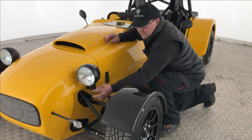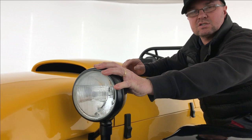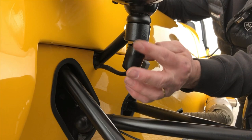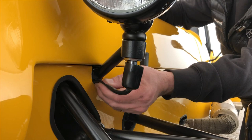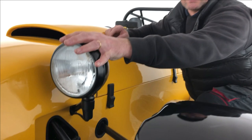Still on the front end — under here is the headlight adjuster. Once you've adjusted your headlight for your beam pattern, they will generally allow you to bring a spanner and make an adjustment on the day, as these tend to have slight movement. Make sure there's a big rubber cover to cover any sharp edges, and that the wires are nice and secure. Every panel the wires go through must have protection from chafing. You can then tighten it up and set your beam pattern accordingly.